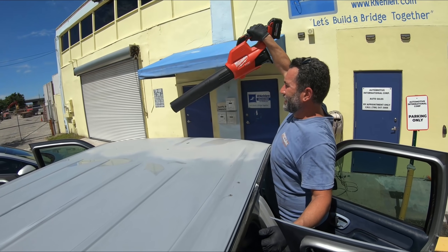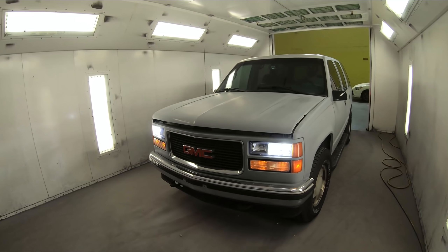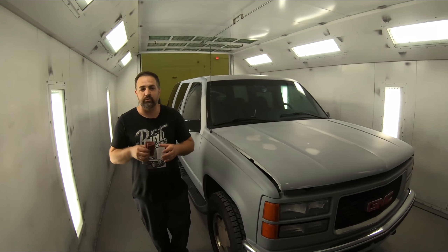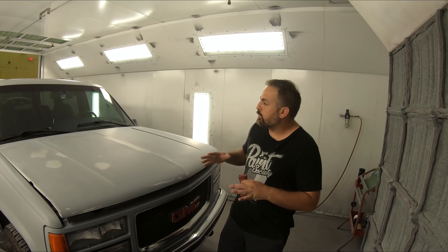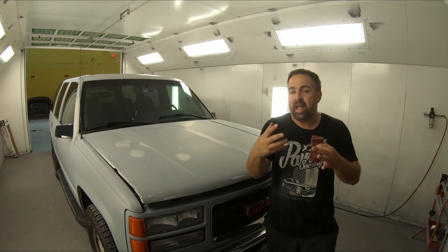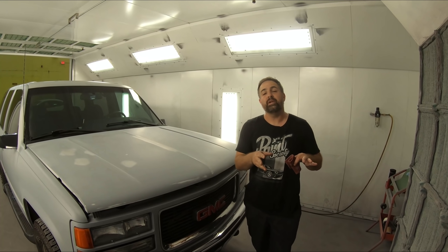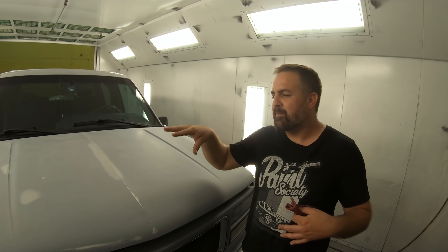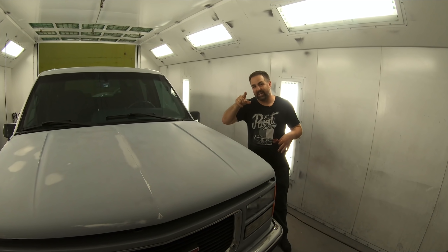We're ready to pull it into the booth. Now a question I already know you're going to ask is why aren't we painting the whole vehicle? Well there's a couple reasons for that. First off it's a two-tone and those require a lot of time and energy to get it all done at once. So what we're going to do is break this into two parts. I'm going to paint the hood and the roof — the hardest places to get to — and then once we have all that eliminated we'll do the sides on another day. The reason why is we don't want to be reaching over and getting ourselves into all of that wet paint. So if you're doing this at home or even a body shop, in my opinion this is the best, easiest, and most practical way to do a big job just like this. Let's get it all masked up.